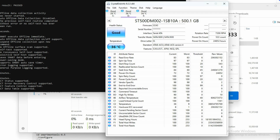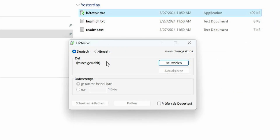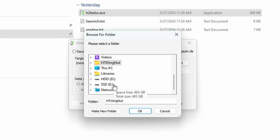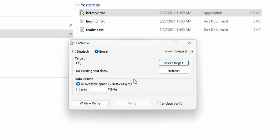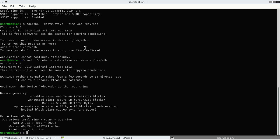Now after you do a full disk write as well as after a full disk read, you should verify that your SMART info is okay in CrystalDiskInfo. And then to detect if your SSD capacity is correct and that it's not a fake, you can use H2TestW in Windows or you can use the F3 probe command within Linux.